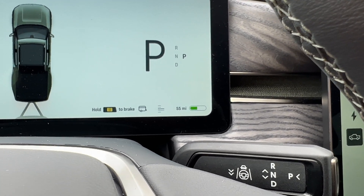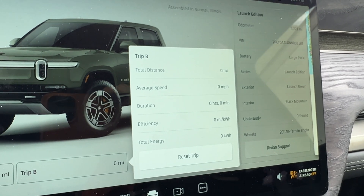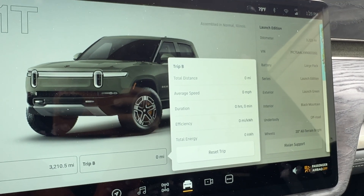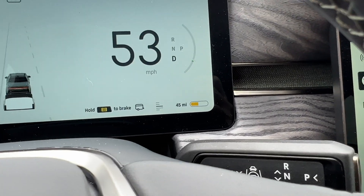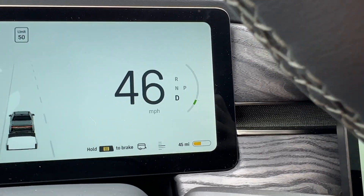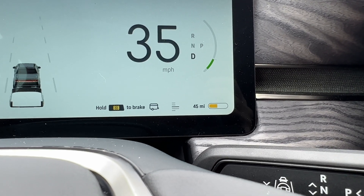We have 55 miles left on the vehicle with just under 50% charge, and we're going to go ahead and start with a zero-distance trip B. I am traveling 11 miles to get back to my warehouse. Some fun information about how the drive is going now that we have 4,000 additional pounds: I've lost an additional 10 miles. I've only been driving for about 30 seconds and just got to about 50 miles per hour. Immediately after hitting 50 mph, the computer adjusted and I'm at 45 miles now. It's definitely registering the additional weight in the trailer.